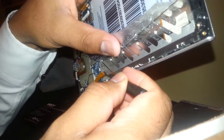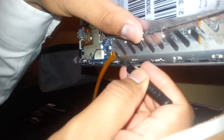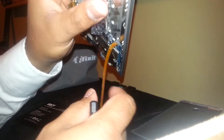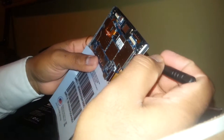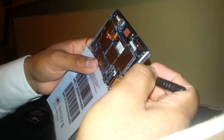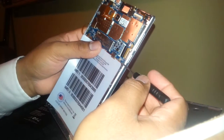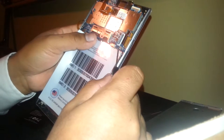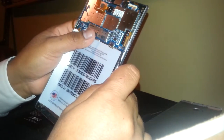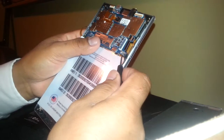Be very very careful here. Now it's totally loose, so we are able to lift the motherboard. You can start from any place — let's start here. This is the coaxial cable — make sure this is disconnected and nothing else is holding it, then pull.